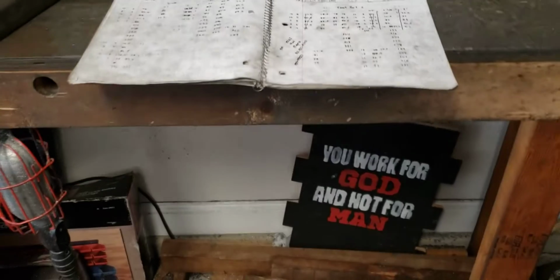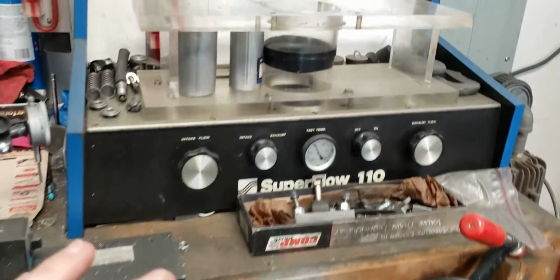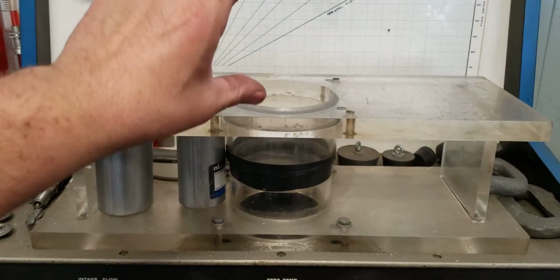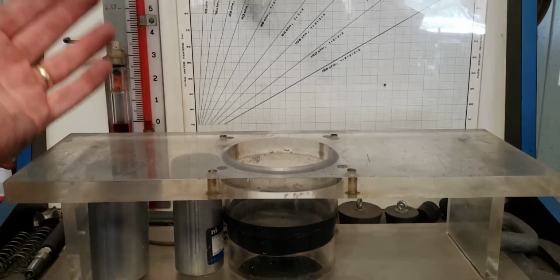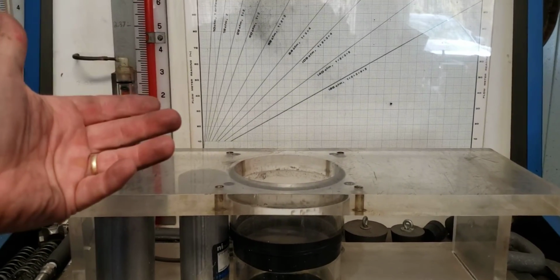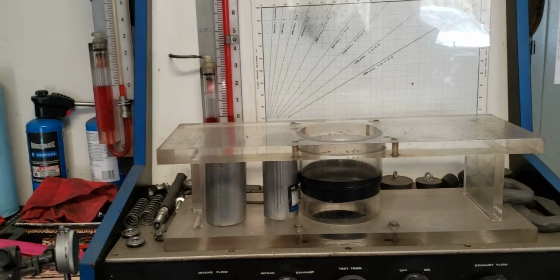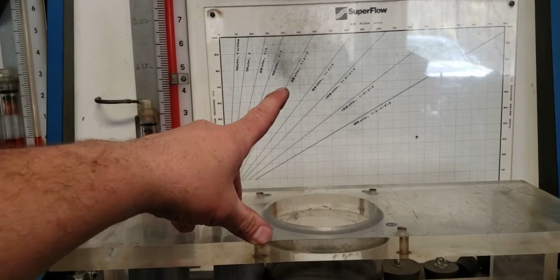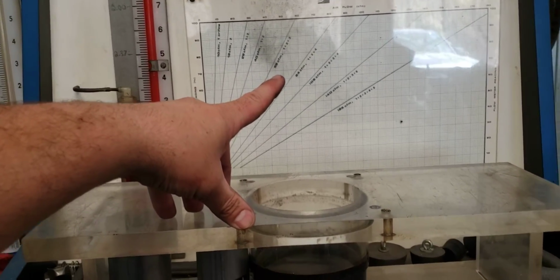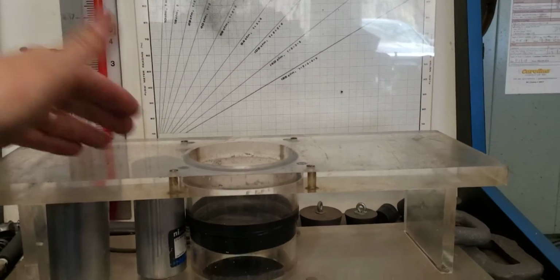Now that kind of leads us back to static versus dynamic port flow like we were talking about earlier. If I open the valve on the bench to a static position, yes, eventually at a certain lift and a certain flow volume, the port will crash. It'll stop flowing air. What's important though is, and I've done it 1,000 times with just the speed of my hand, if I pop the valve open and shut it, the bench never stalls. And that's basically what's happening in your cylinder head.